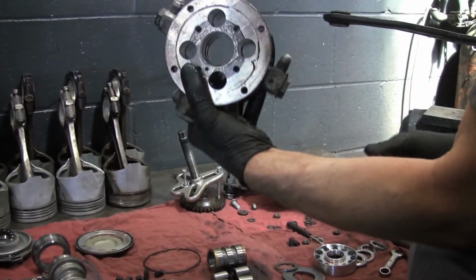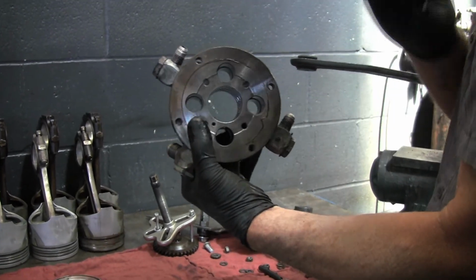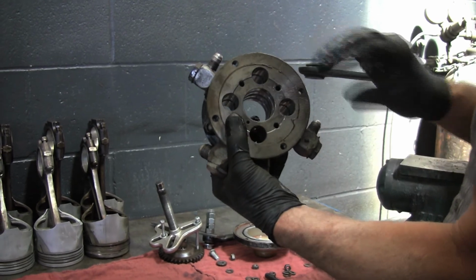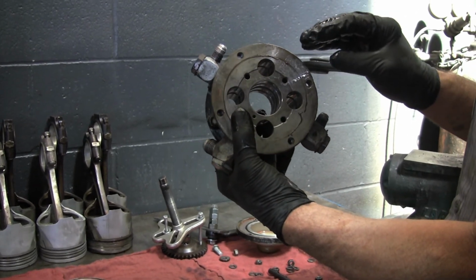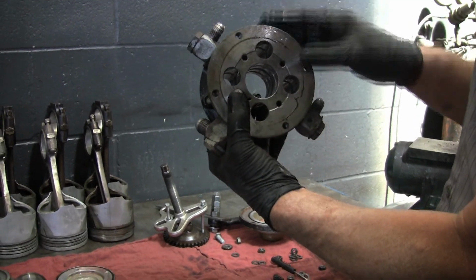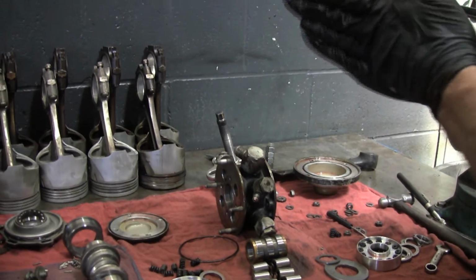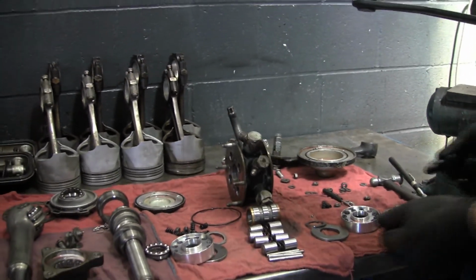Here's the inside. Very precise fit. If you get too much clearance in there, it won't work at all. So you can't sand them. Don't ever take sandpaper to anything like this. To make them move better, Scotch-Brite is about as far as I'll go with this. Scotch-Brite is like an abrasive pad that's not too abrasive.